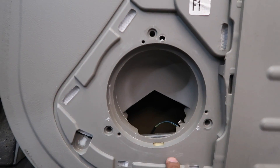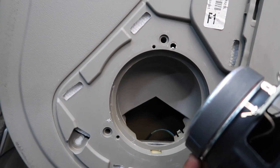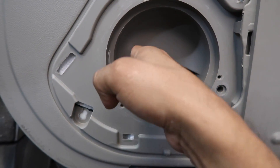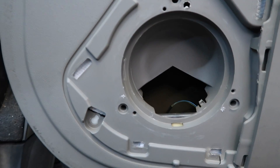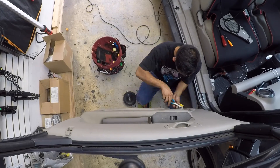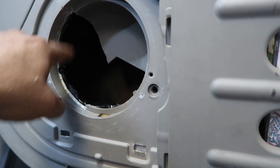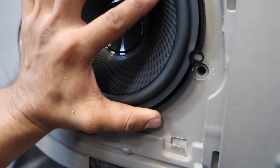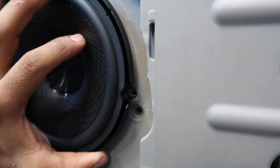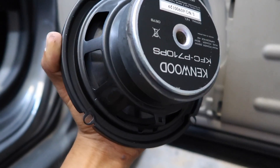In the speaker opening we have a six-and-a-half inch hole but the inside is like a five-and-a-quarter, so our speaker terminal is not going to fit. We're going to cut this part right here so the terminal can fit in, then we'll foam it and connect it. We cut the left side of the panel so the basket can sit right on it and the terminal is free. Make sure to put the terminal on top so it doesn't rest on any metal and cause problems.